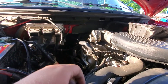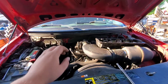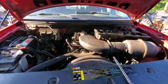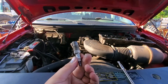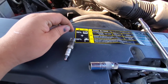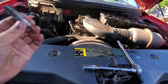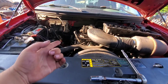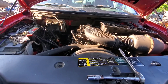But the 5/8 spark plug socket didn't pull that plug out of there, which was kind of weird. So I grabbed the 9/16 plug socket and just fought that spark plug out of there — it was a pain in the ass. I really thought I was pulling out a threaded insert. But no — do you guys see what I'm seeing here? That's a 3-valve spark plug. It's got the wrong plug in it. A 3-valve plug, instead of just going down threads with a little strap on the end, they come out about this far. So I'm going to need the borescope to look down in that hole and see if the rest of this plug is even there. I'm going to guess that ticking noise is what's left of that spark plug having gone through a piston. Let's get the borescope and look down in the hole.